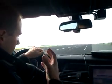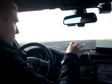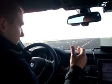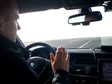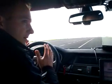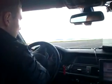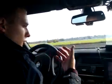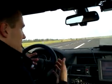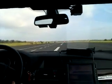And for this problem, we thought of a new approach that replaces the acoustic beep with a downshift in the automatic gearbox. So at the moment of the warning, we're shifting one gear down. And what happens if you shift down? It's just like a longitudinal dynamic movement. Okay? And for the distracted driver, this longitudinal movement serves as a warning. But for the overtaking driver, it serves as a support of his overtaking maneuver. It actually helps him to overtake the car more easily.